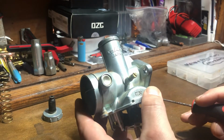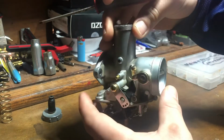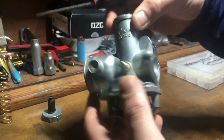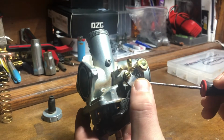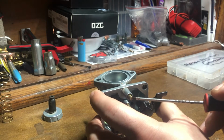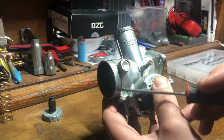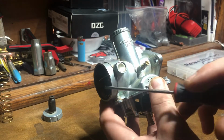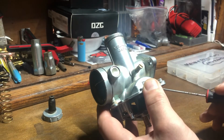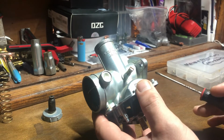I'm not going to go too in depth about that, since it's tomato, they both do the same exact thing. It's just where they're positioned and what they're referred to. If they're closer to the fuel area, for example closer to the gas inlet or underneath, like on the clones, they are referred to as your fuel mixture. If they're closer to where your air filter mounts for the air inlet, then they are referred to as an air mixture screw. But either way, they control your air-fuel ratio for the bike at idle to around quarter throttle.